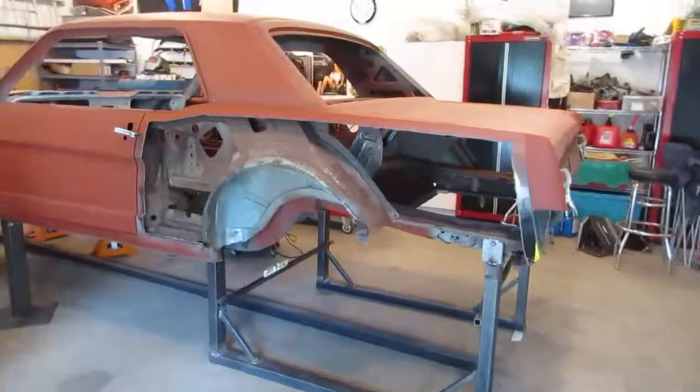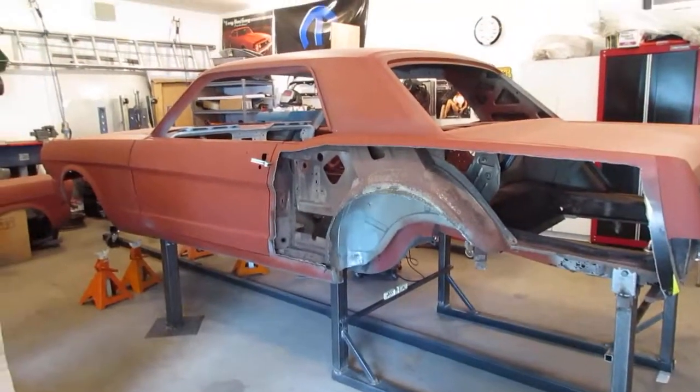...and off of where the rear spring eye would be. This will allow me to pretty much just cut the rear frame rail off where the metal is still good, patch in the replacements, and let that fixture properly locate both the height and distance back from the front spring eye that it should be.